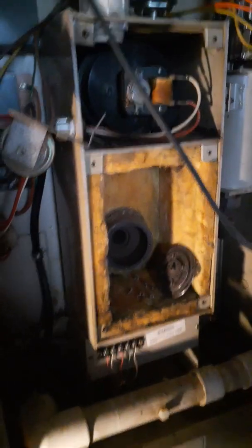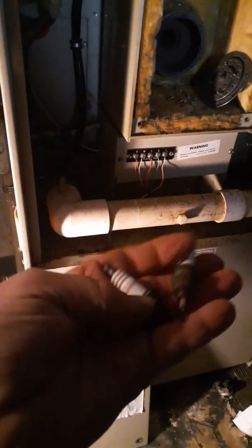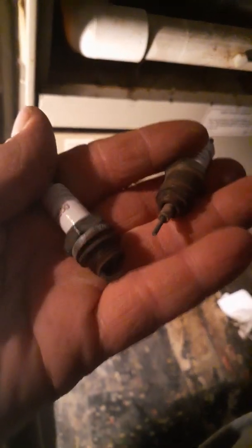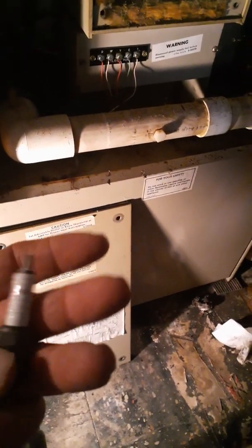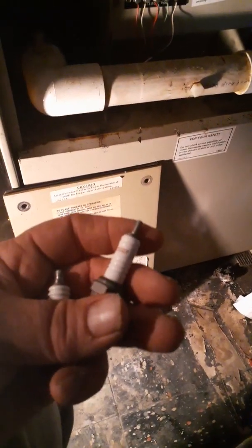What it does is fire a spark plug right here. It looked pretty roached, and the flame sensor looked pretty well worn. I believe they were working, but I replaced them anyway. I got on eBay and found them — they are F121-500 and F121-507 — that's what's on there.